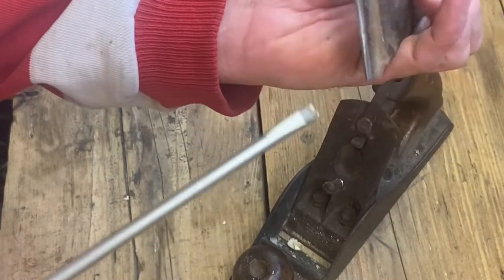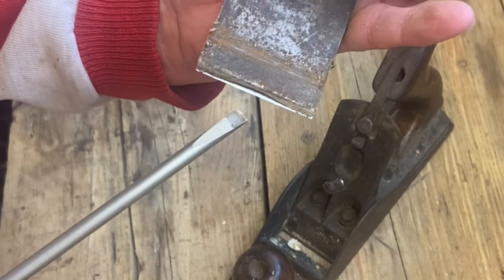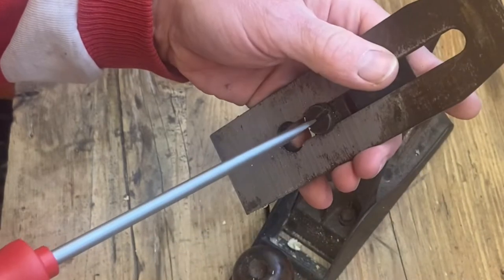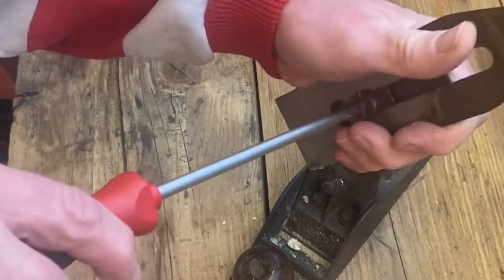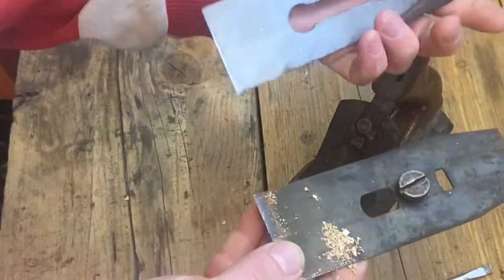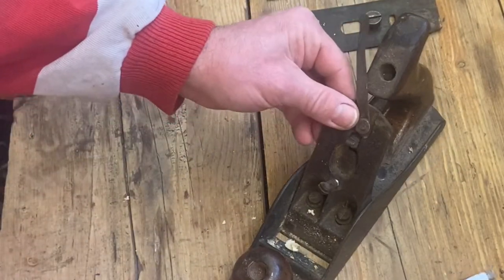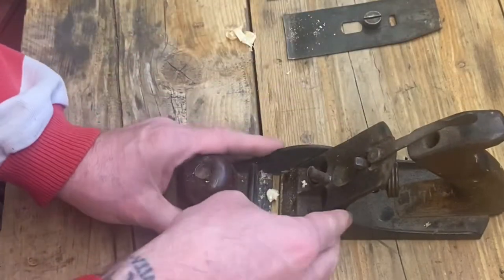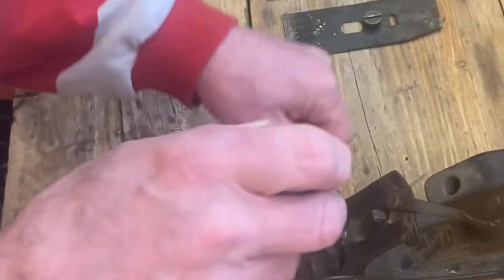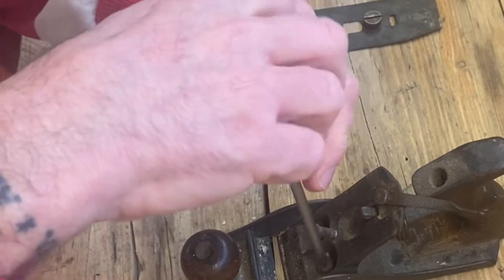This is the iron or blade, and you can see they're almost exactly aligned — just a couple of mil. We'll remove that screw and just slide that up and pop it out. You can see there's some dust just inside there, so that's three parts removed already. We then need to remove these two screws here which hold this part onto the cast iron base.